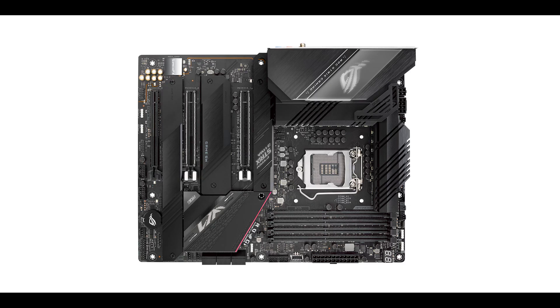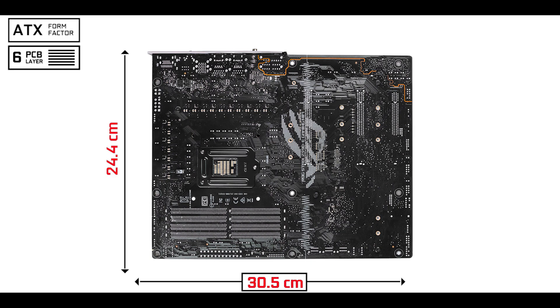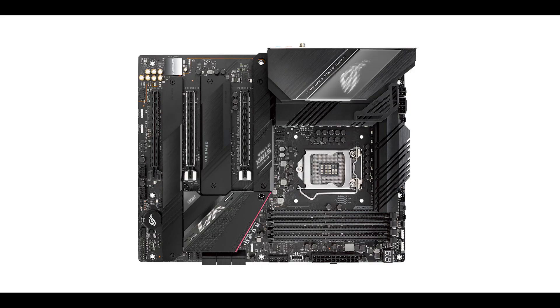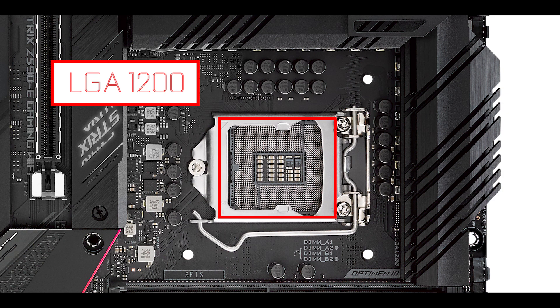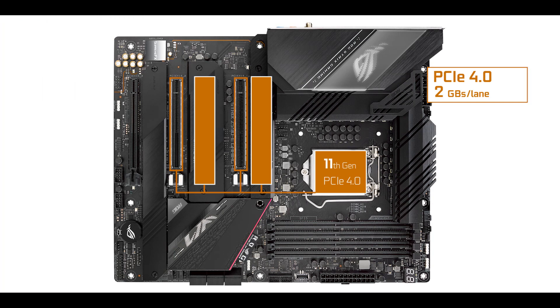In short, this preview is a big deal, and I still do not have all of the details and specifics of this board, but enough for us to have a good idea of what's going to hopefully hit the shelf later this month. Starting with the obvious: we are dealing with a 6 PCB layer ATX motherboard, which was fully expected knowing that this is a PCIe 4.0 enabled board. The LGA 1200 CPU socket will support both 10th and 11th generation Intel Core CPUs. Only the incoming 11th gen processor is PCIe 4.0 enabled, feeding double the bandwidth that PCIe 3.0 can to the most performance-centric components of your build.